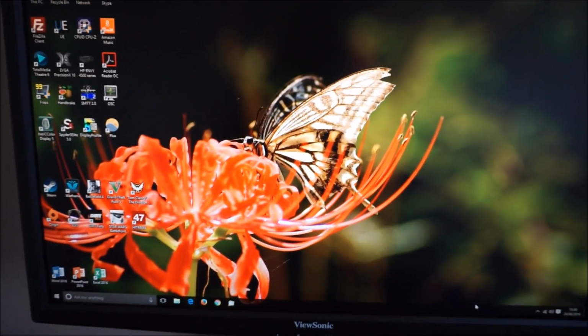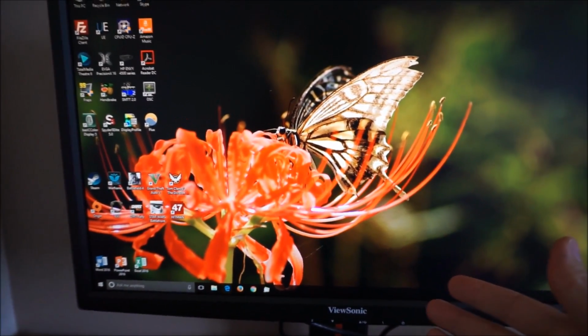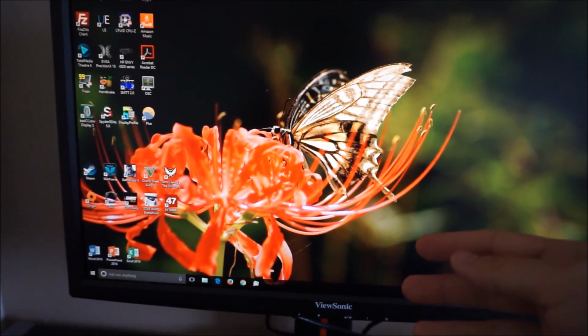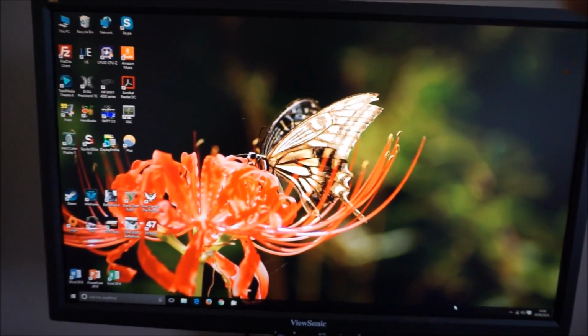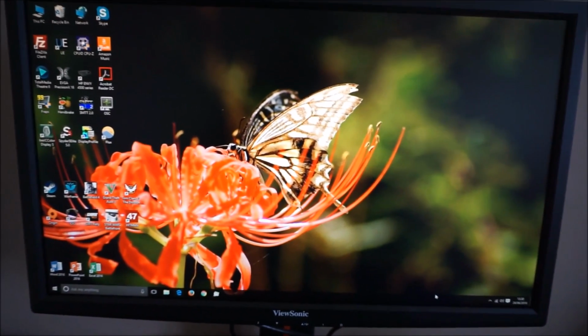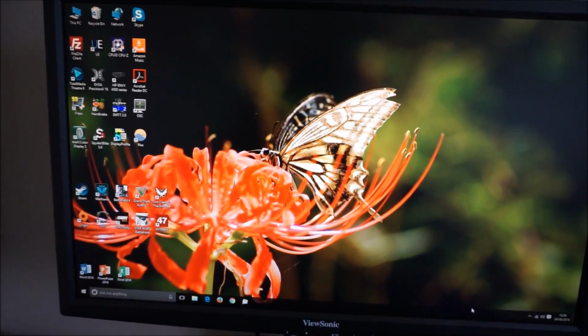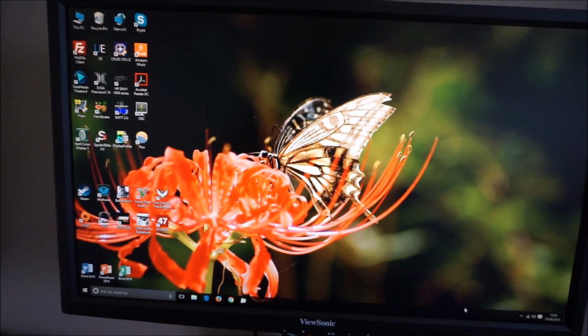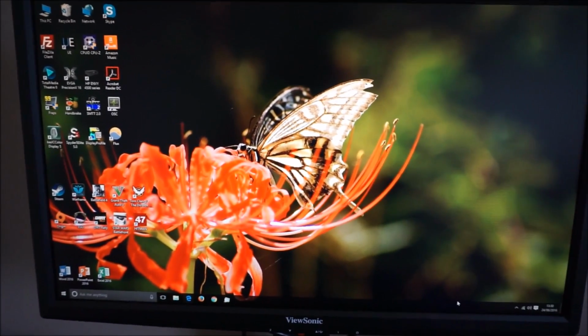Being a twisted nematic panel, you do get weakening saturation further down the screen as the perceived gamma changes, and also further up the screen things become more saturated. But on the whole, this does give a rich look to the image. It's not washed out in the way that lots of other 24-inch gaming monitors are, thanks to the gamma handling. So that's a nice thing.